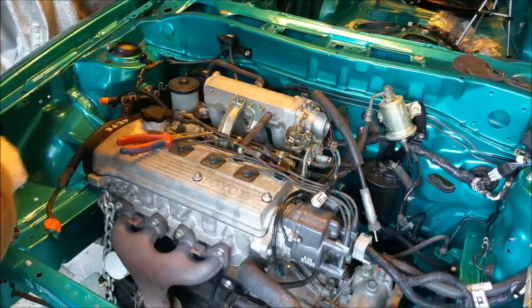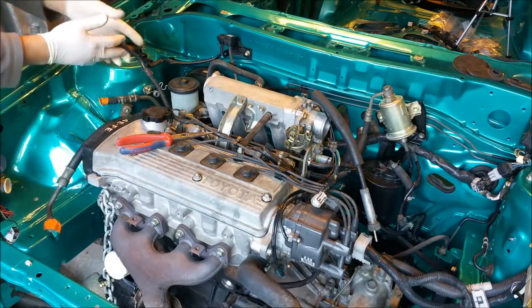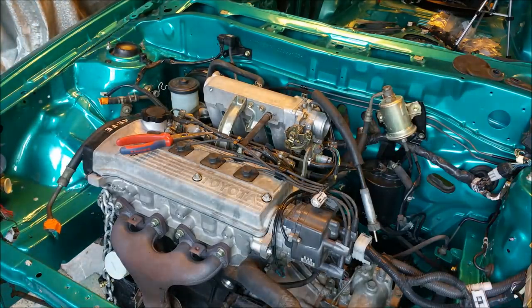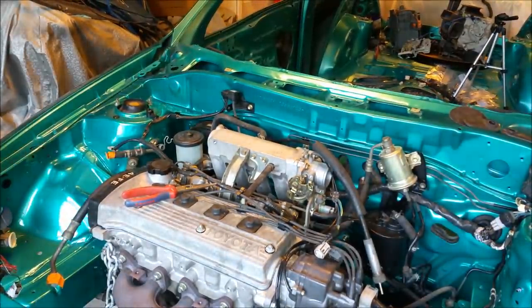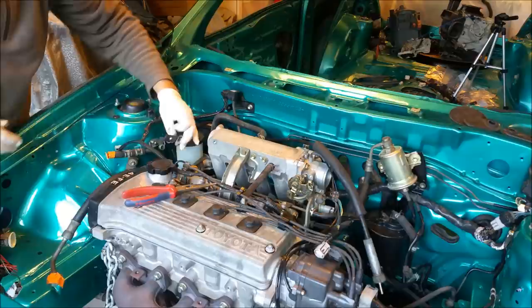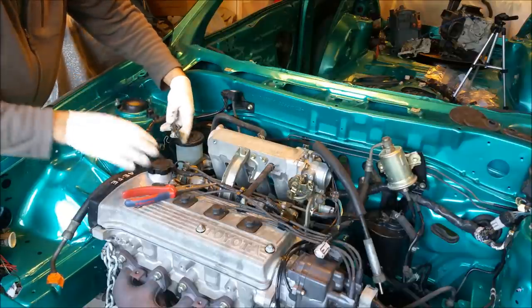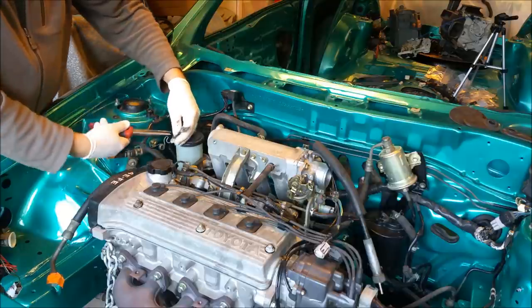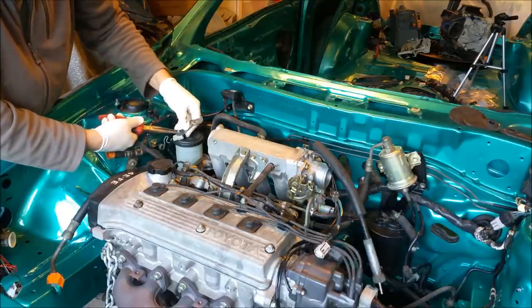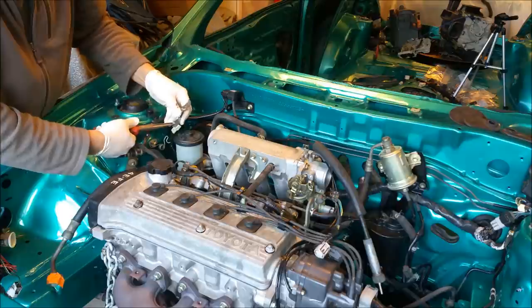And there. We've got a master cylinder switch over here. I'm not sure if you can see where you are. Yeah, you should be able to see it. Non-power steered cars have a bracket that holds it to the firewall, or to the shock tower. That's what that is called. This one doesn't because we've fitted power steering to it, so we can do away with this one.